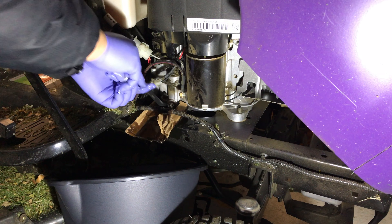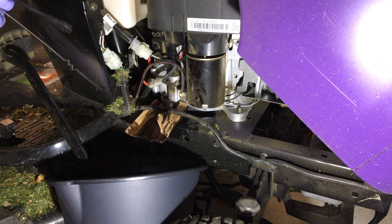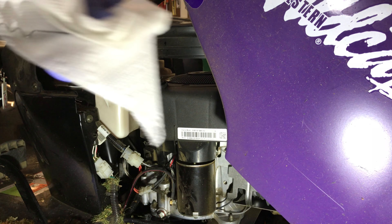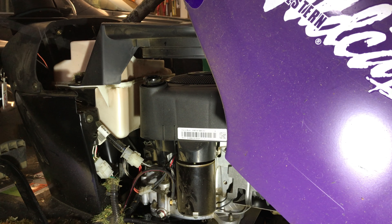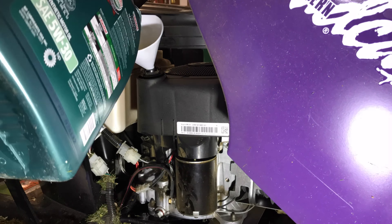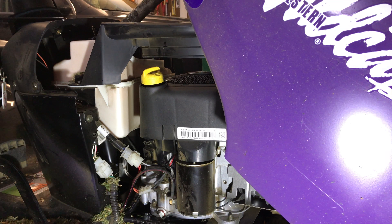You want to just tighten this bolt back in. Now we just remove the dipstick and cap completely, put the funnel in, and start filling it up with 5w30 — I think 1.4 quarts is what it recommends. Basically there's a low and high mark, so we just want to be in between there. We'll add about a quart, put the dipstick in, see where it falls, and then just keep topping it off. There we go — got it topped off, right to the top of the fill mark, just to make sure I have plenty of oil as any of it leaks or burns off. Now I'm ready to go for the next season.